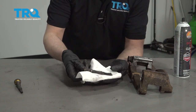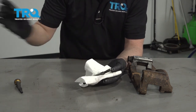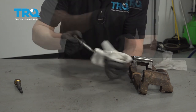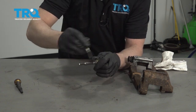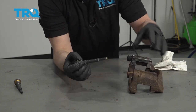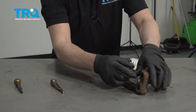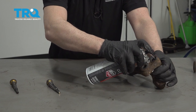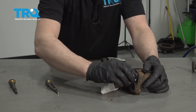Now we're going to clean up the brake caliper bolts or slide pins. Use some brake parts cleaner and just wipe them off. Take some brake caliper grease and apply a nice coat — do the same on the other one. If these pins were really corroded fairly badly, you're going to want to clean out the bore of the caliper bracket where that pin went. Take some brake parts cleaner and clean down in there. You might want to use a wire brush as well — just clean that out.